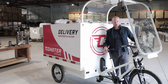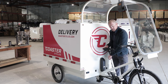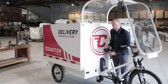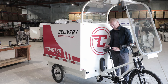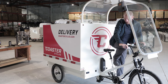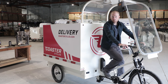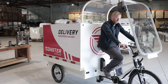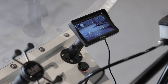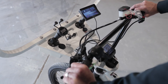The next thing we're going to want to do is make sure that everything's comfortable for the rider and set up safely. Starting with the saddle — you can adjust this up and down, and you can even adjust the fore-aft of the saddle if you want to, but it's not a quick release; you'll need a wrench to do that. For most cases, the fore-aft of the saddle should be sufficient. Hop on once you've got the saddle where you think you want it, make sure you can reach the full pedal stroke, and again check your brake levers. Make sure everything feels comfortable and that you've got a good field of vision. You can also check the backup camera — make sure you've got a clear view and there's nothing obstructing the camera — and that your Bosch display is powered on and ready to go.